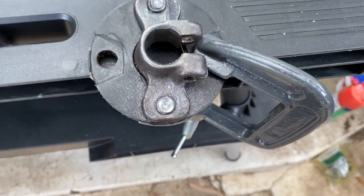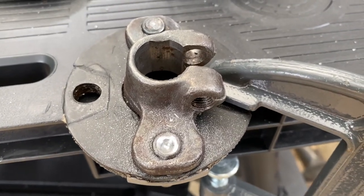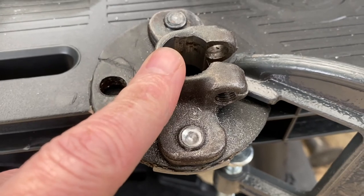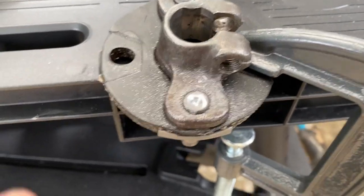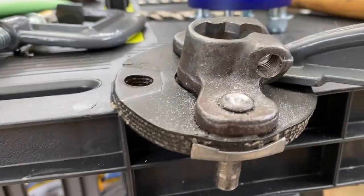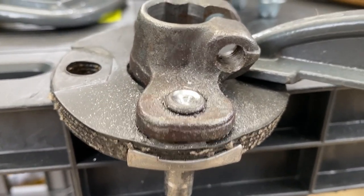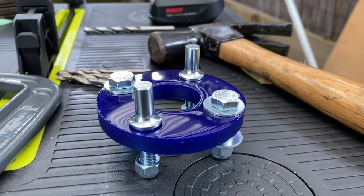Okay, so this morning I'm trying to get these rivets out of the steering coupling, because I need this mount that goes into the power steering box. So these actually spin around, but I'm having a lot of trouble with a drill trying to drill it. I've already broken a couple of bits and it's proving really tricky to get out. I want to be replacing it with this guy, which looks very shiny and new.